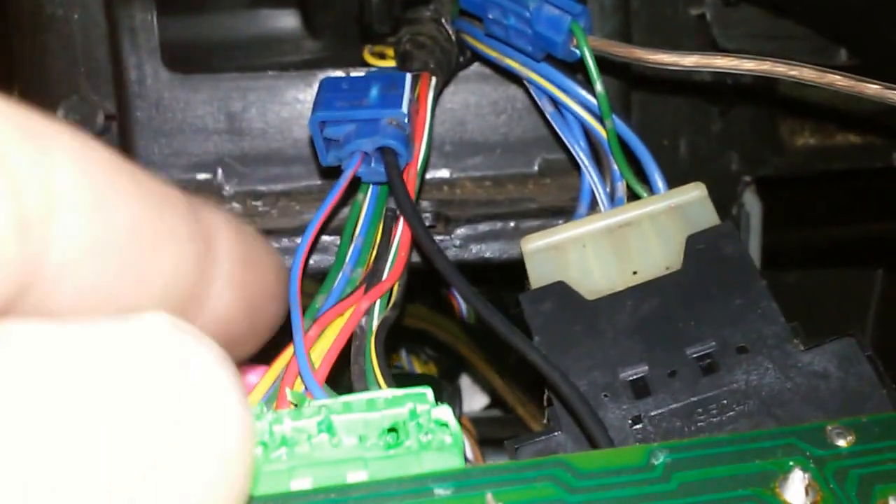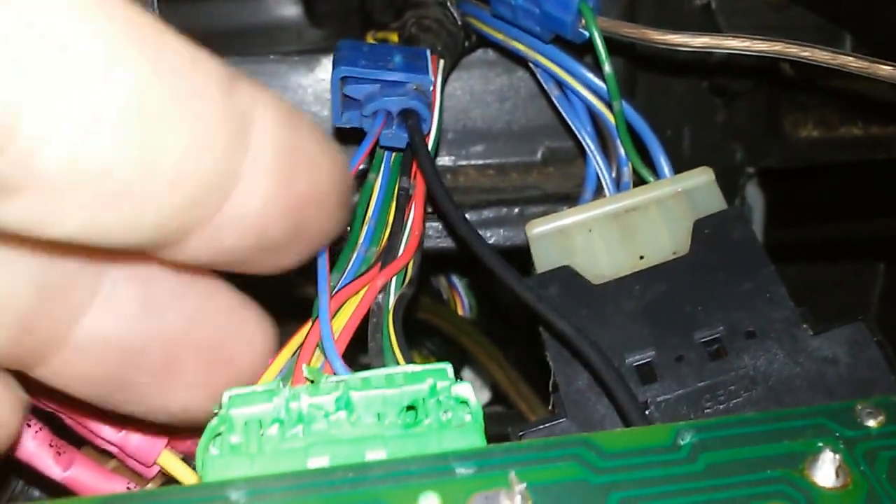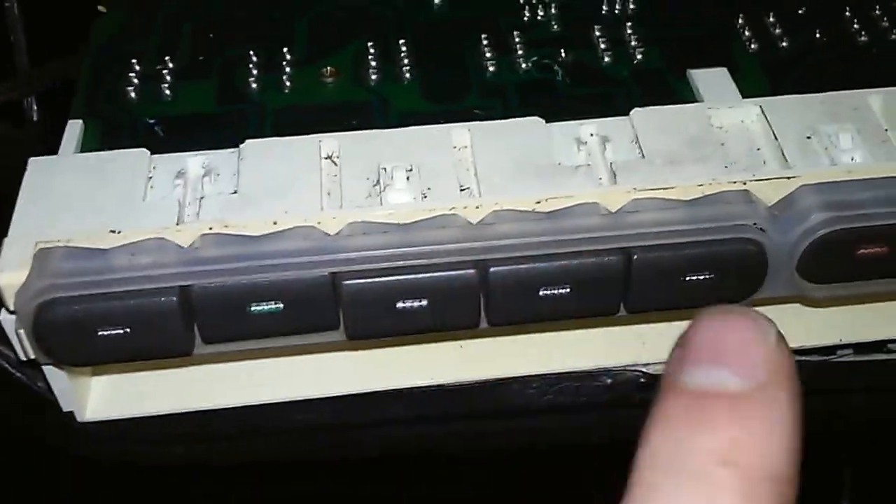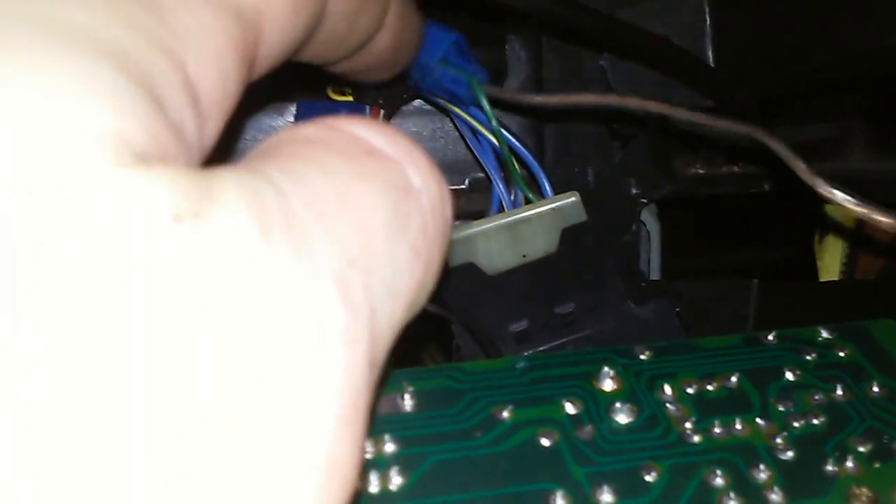What you're looking for is the blue and red wire. There's only just the one blue and red one on the main connecting harness that goes to the fan control head — that's the one with the position buttons, recirculate and vent, and the air conditioning button.